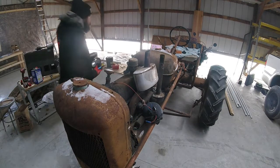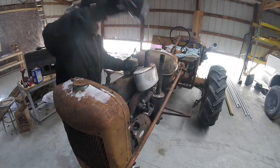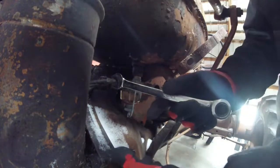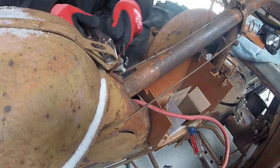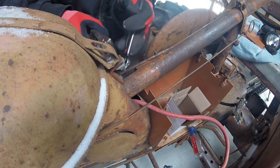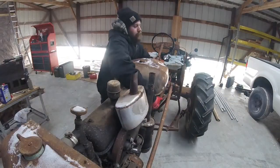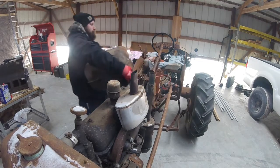Next, I'm just going to cut the wire for the lights here and set those someplace out of the way — those were added afterwards. And then we disconnect the fuel line on the gas tank, as well as the rear screw. This screw was definitely not the original and I had to put a vice grips on the threads to get it off. But with that being done, the tank comes off.